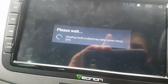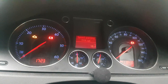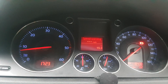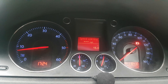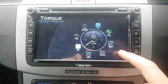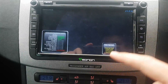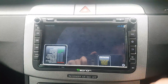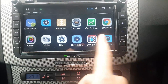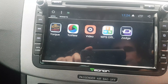Send clear command — clearing fault codes may take some time. So the fault codes are now gone. The light's still on, but what I need to do to clear it properly is turn the engine on and then it disappears — gone, just like that. It'll probably come on again because, like I said, it's a faulty sensor. Anyway, I hope that helped with all your queries about how to set up your OBD port. It doesn't have to be the one Enon supply — I've got an Enon head unit, but any OBD2 Bluetooth dongle should work, providing you've got the same app as me. I think it was about £3 off of the Play Store — so yeah, not bad.